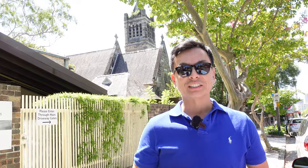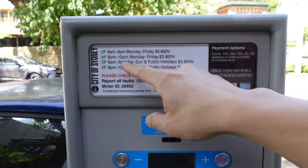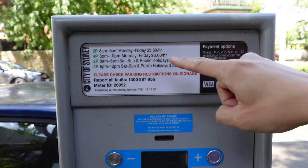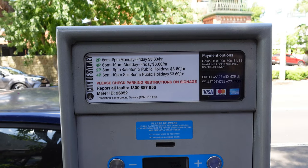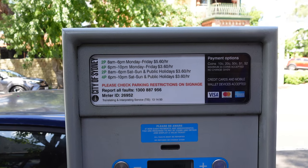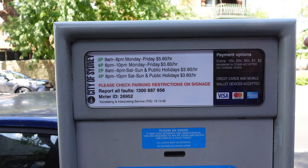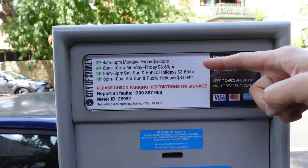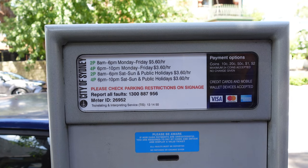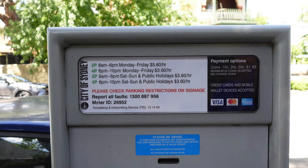Just a note: in the hours between 8am and 6pm Monday to Friday it's $5.60 an hour for parking, which is pretty much the charging window shown on the street sign. At 50 cents per kilowatt hour, if your car is drawing 11 kilowatts, that's basically $5.50 an hour — almost the cost of parking, but you get charging included at the same time. Good comparison there, and thanks to Joy for pointing that out.